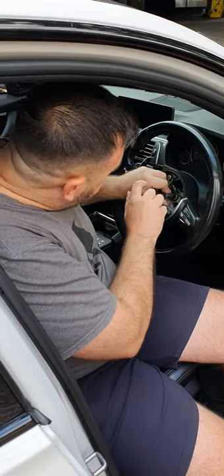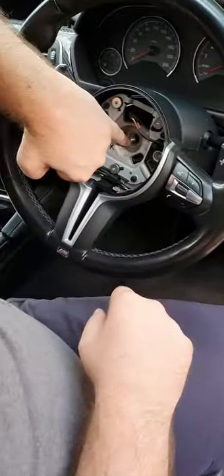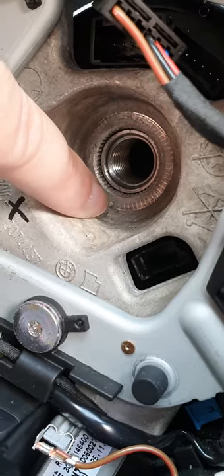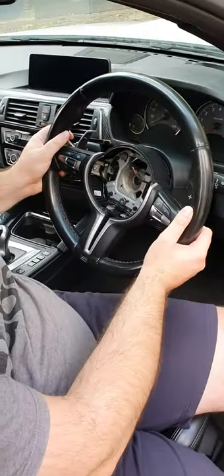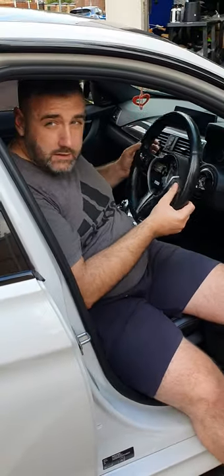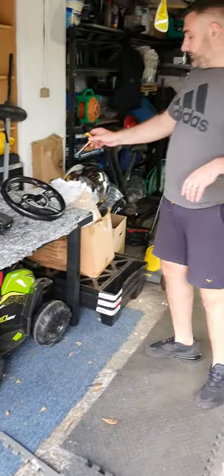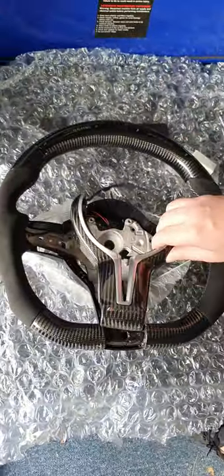What I tend to do when taking this off is keep the bolt with the ratchet so they're in the same place — somewhere safer than on the floor in a car park. If you look in here you can just about see there's a notch cut into where your steering wheel mounts, and there's also a notch in the steering wheel itself — that's how you know how to line it up properly. You've got a series of teeth around the outside, so when you're putting it back on make sure those notches line up. Remove it slowly because if you haven't quite got all the wires out and you start yanking, you'll pull them out of the connectors. So we're going to take this to the garage and start swapping the components — taking off the interior plastics from Joe's old wheel and putting them onto the brand new Foreign Customs special edition LED wheel.